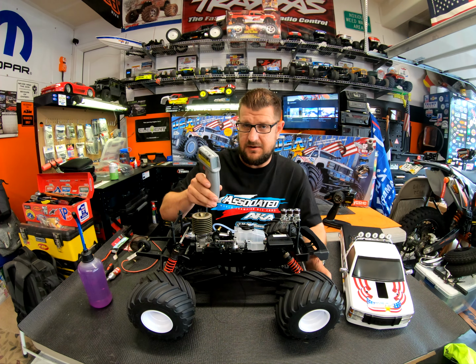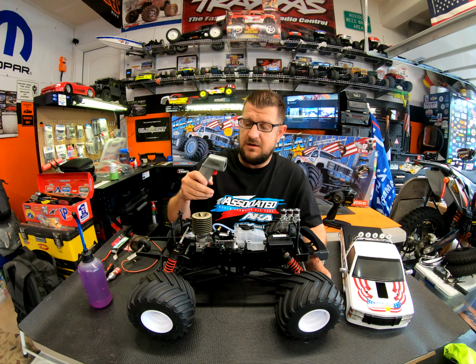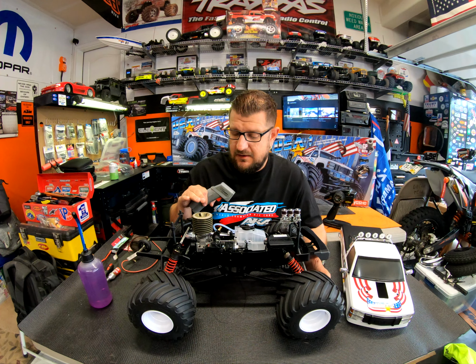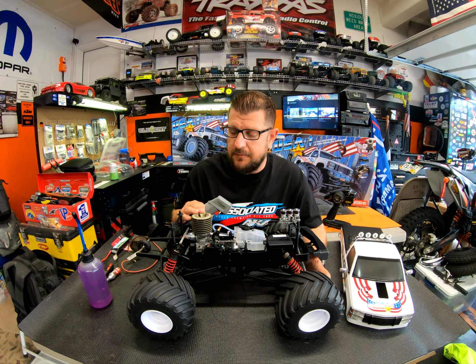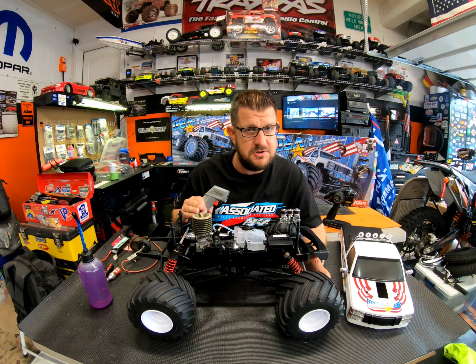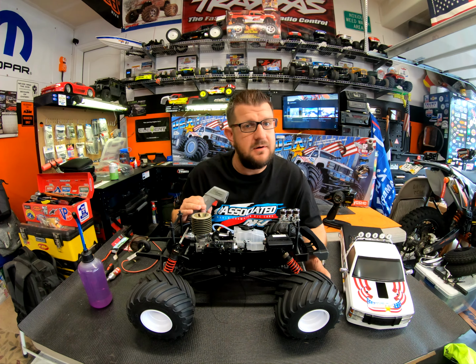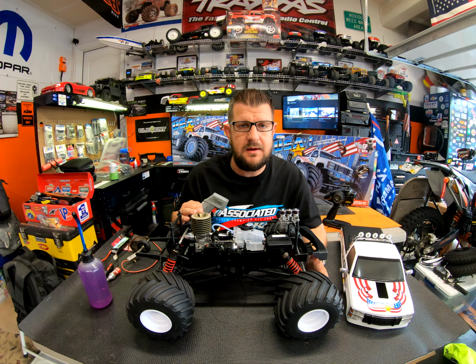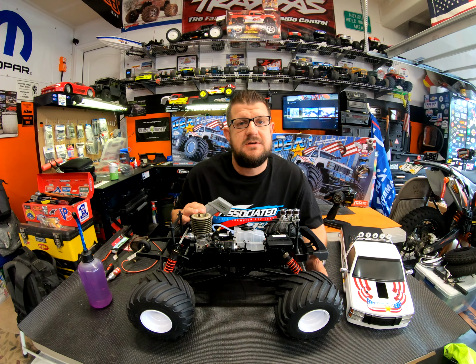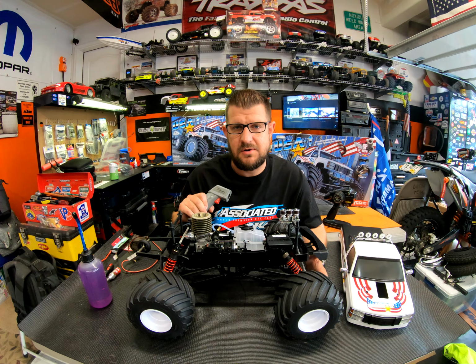Next is a temperature gun, an infrared temp gun. This is going to be important because it's going to tell you the temperature of the engine. And during break-in, maintaining a good temperature on the engine is critical. On the first few heat cycles, which I'll go over here in a second, keeping the engine up to temperature is the most critical thing, because when you're just idling, especially if it's a colder day like it is here today, you need to make sure this engine is staying up at operating temp, because heat cycles are the key thing to breaking in these engines.